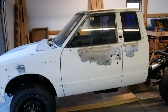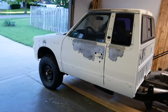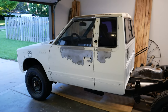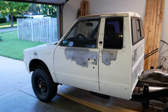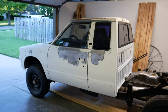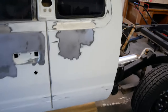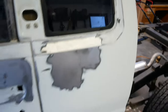If that still pulls the paint, what I'll probably have to do is prep the entire truck even harder — probably down to bare metal — and we're talking a full-on primo paint job and something really cool. I luckily have access to a booth and can basically just buy the paint and spray it with a friend. Now, if you wrap over bad paint and ever go to peel it off, you're going to take all the paint off underneath it and probably be in a worse state because of it.